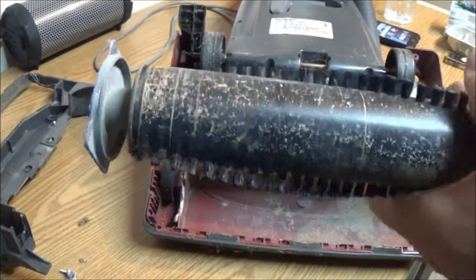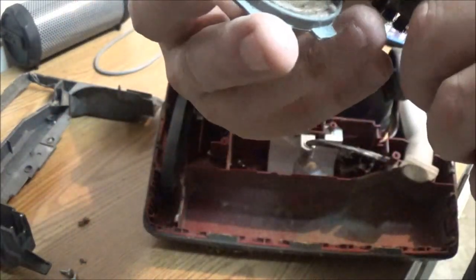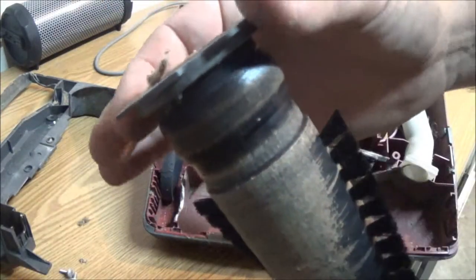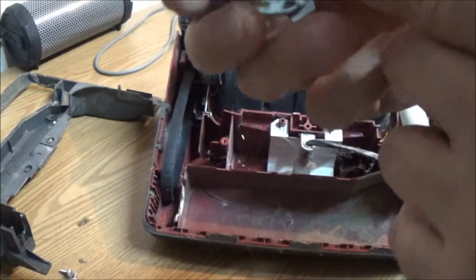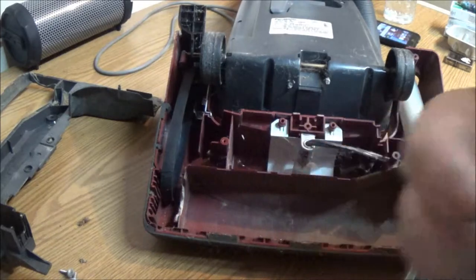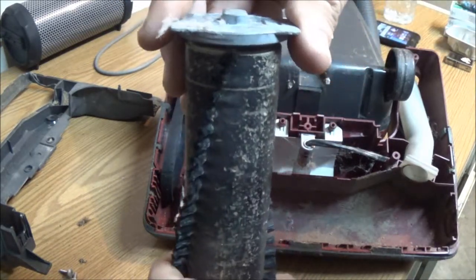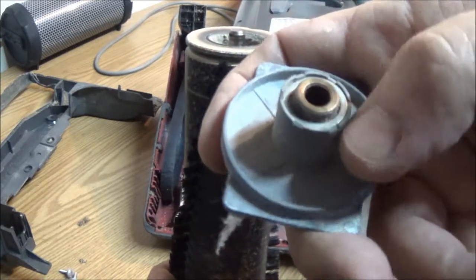This spins of course. You take these ends and you can check them. It seems very dirty — there's like a piece of carpet wrapped around in there; that'll also cause a clicking noise. Make sure there's no excessive side-to-side movement. Now a lot of people call these bearings, but it's just a brass bushing — there's a difference between bearings and bushings. The clean end feels pretty clean, but there is side-to-side movement on the other one — that's telling me something's worn, probably the brass bushing.